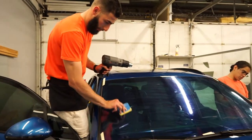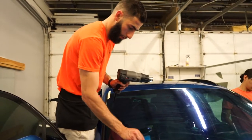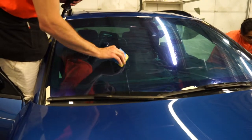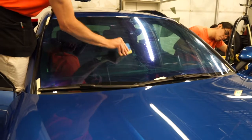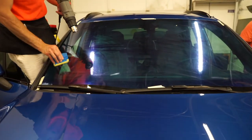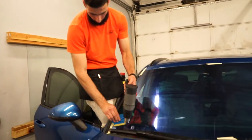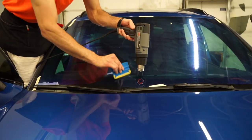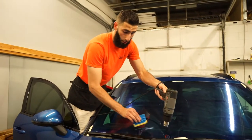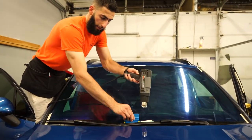So we're about done. I've just got to push out all the air out of this bottom one. If you do it right and you apply enough heat from underneath, you should be able to just squeegee it out completely without any fingers or anything at the bottom. It's got a couple fingers under the windshield line, but we're going to go ahead and shrink those down as well, so that way we don't have any fingers pop up when we install. It is always a good idea to go over the bottom with the heat gun and squeegee and just hit it with heat — make sure there's no fingers that pop up. And then we'll go ahead and cut out our film and then install our windshield.